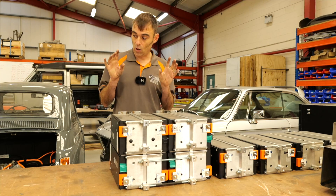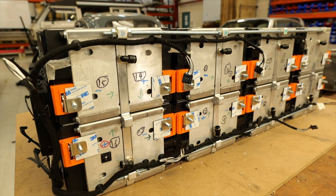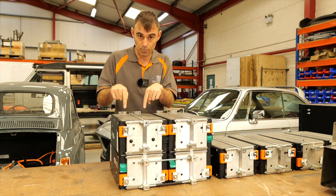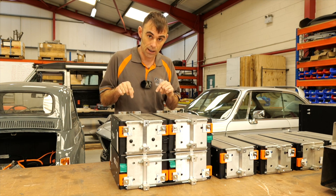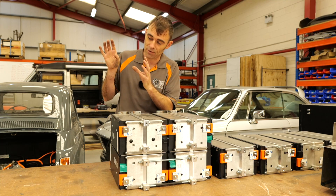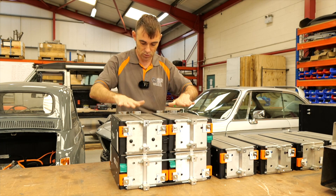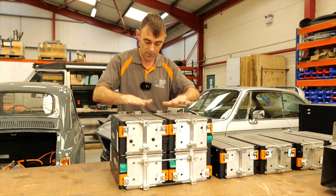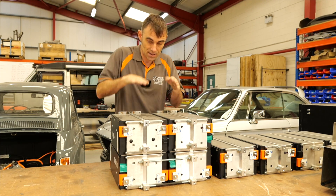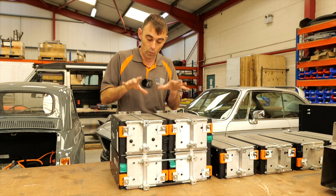We've got the big battery pack over to my right-hand side, and the guys are busy doing the BMS looms over there. But I wanted to show you what we've done with the front battery pack. In total, there are 24 of these CALB modules, and that's 61 kilowatt hours — a 61 kilowatt hour battery pack. The front battery pack was going to be so easy: one big pack in the rear, one in the front. Then I came along and ruined it, because I felt it was too high and we lost too much luggage space. So we've taken off the top layer of four modules and split them into two pairs, making the front battery pack a lot shallower. I'm going to bring in my glamorous assistant to help rearrange these so you can see what we've actually done.